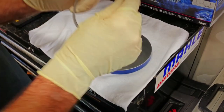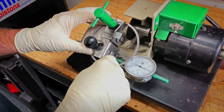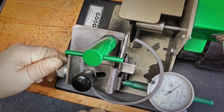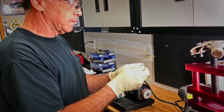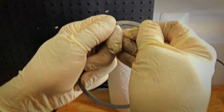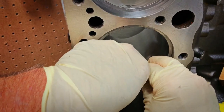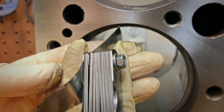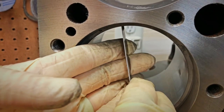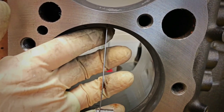It's tight and butted together. We come here to my favorite tool — ring gapping tool. Butt's up exactly flat. Burrs get slightly taken off. We check in here and make it nice and even. 30 thou — still a little too tight, just a hair. Do I have to take a little more out? About one more thousandths. And it is just a little snug. That's good.